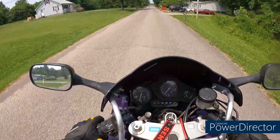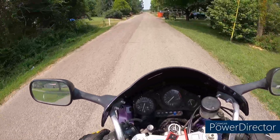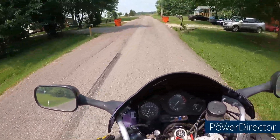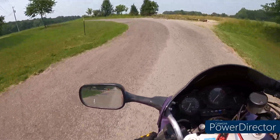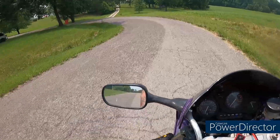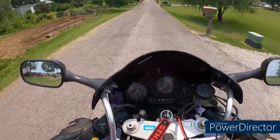I love this bike. It's got plenty of power. I did change the sprocket on the front — I put a 15-tooth sprocket on it and it turned it into a wheelie beast. It feels good, it's comfortable to ride, and ergonomically I'll be completely honest with you: this bike is more comfortable for me to ride than the R1. I'm 5'9" and I slide back in the seat on this and I'm not stretched out like I am on the R1, because the seat is so much longer on the R1 — about two and a half inches — and it makes a huge difference when you're a short guy.